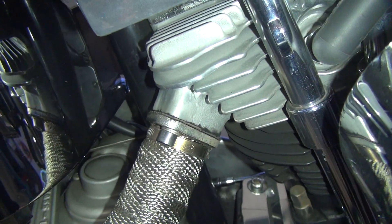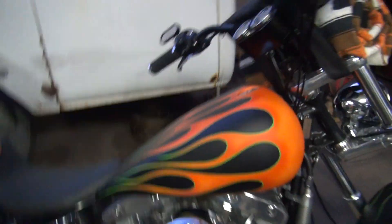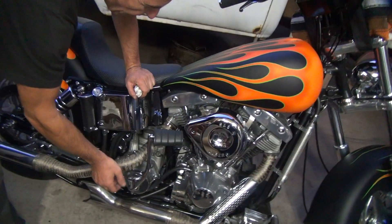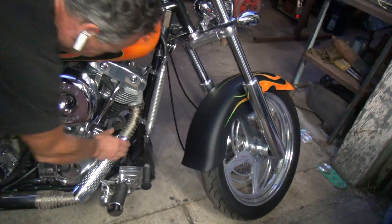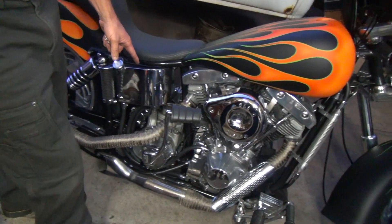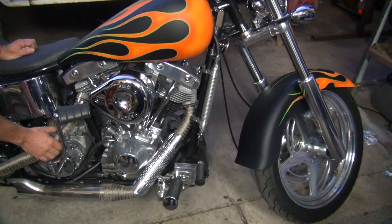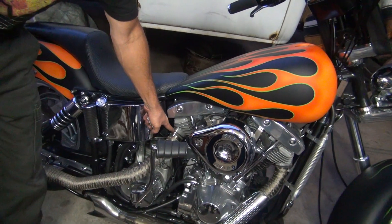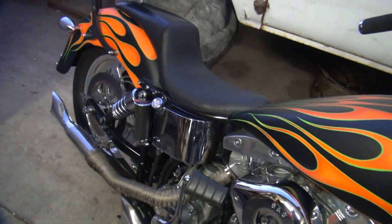Those double counter-tapered washers are still holding tight, which is impressive. Everything is still pretty snug. The bolt appears to be very slightly loose — it'll need to be torqued — but it hasn't fallen out after 1100 miles of riding, including burnouts on a 93 cubic inch stroker motor that vibrates a lot. Pretty impressive that it hasn't wiggled out.